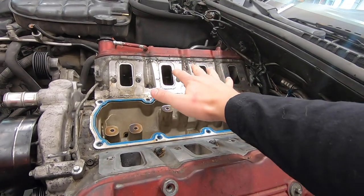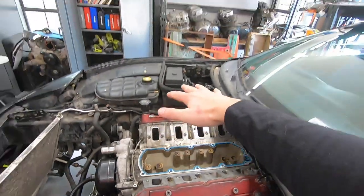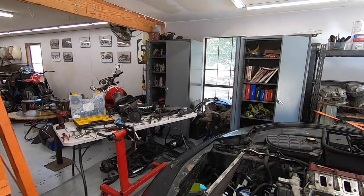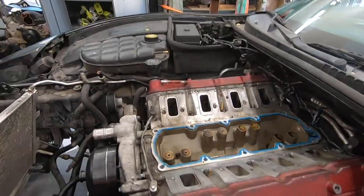Ideally, that load leveler is as low as possible to give me as much clearance as I can possibly get. Also give me enough clearance when I come up that I can clear the front of the hood or the front of the bumper and everything to get the actual engine out. I don't want to run out of vertical space halfway through.